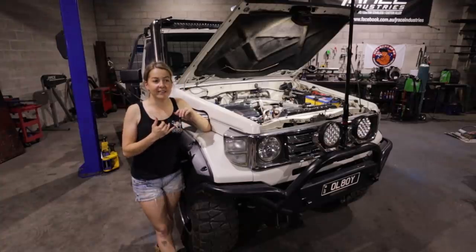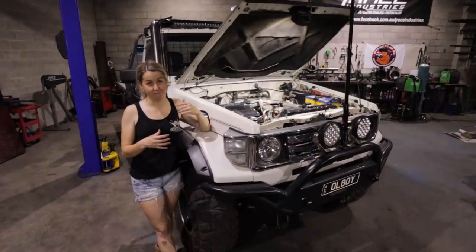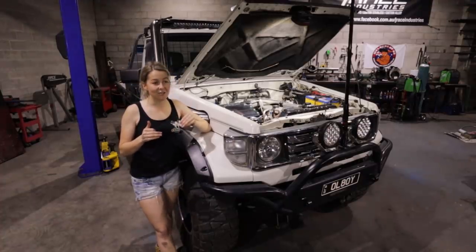Probably monitor the secondary fuel filter and look for water in that bowl, then drain both fuel filters. Reprime the system and go again. Maybe drain the tank if you think it's that bad. Overall, great mod.